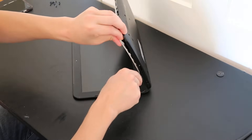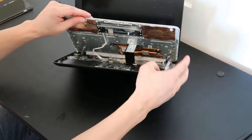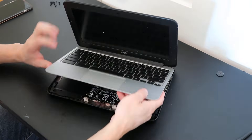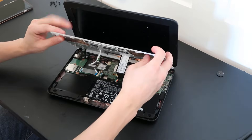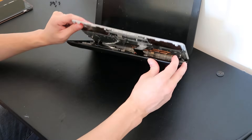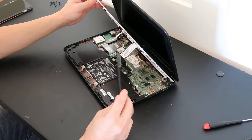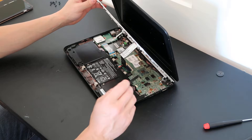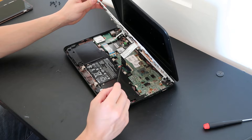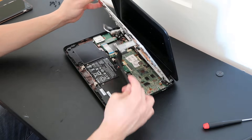It took a little finagling but it's come loose. Make sure nothing's holding it on. As you can see, there's a ribbon cable here and a ribbon cable there — that's why you don't want to feel it's free and just rip it off, you'll end up breaking things. I'm going to use a plastic pry tool now, not a metal one, because I don't want to go poking around the motherboard and making unintended connections. I'll free these ribbon cables and then show you how I did that. There's your palm rest.